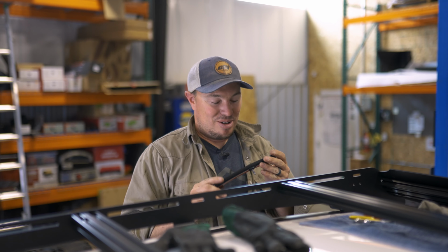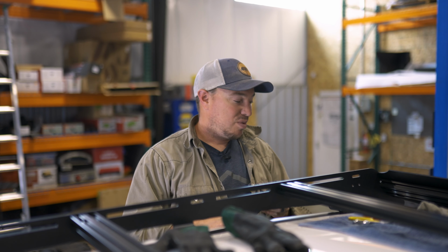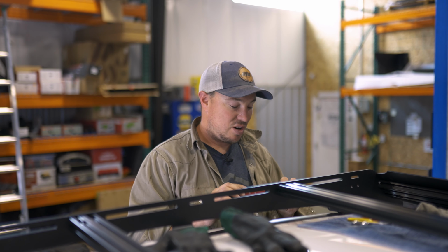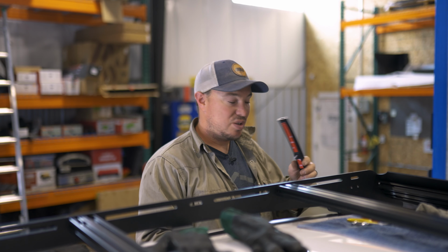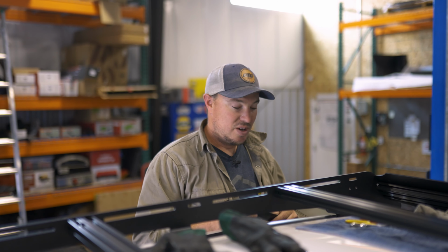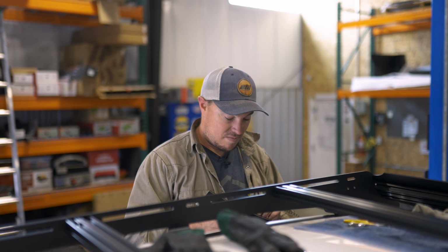All right, so all of our gutter trim has been cut. We're gonna apply our double-sided tape to the back side and get everything stuck down and secured. This front one, we're able to reuse this stud through there and thread the nut up and tighten it down. So we'll go ahead and get this all stuck down.